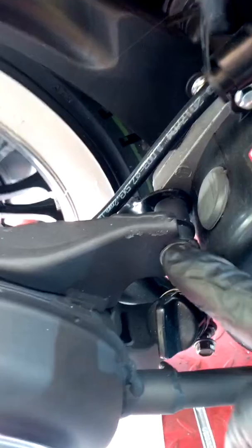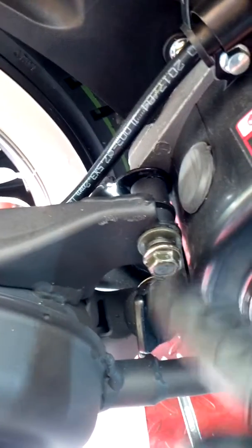The first thing I do is take the side panel off and then I loosen these bolts. When I've taken them off I always copper grease them and put them back in again, just in case you need to get them out. I'll just use a copper grease. You're going to need a 12mm spanner — there's one there and one down there. I've taken that one out down there and there's this one here which is hand tight.